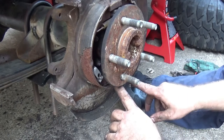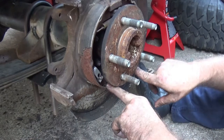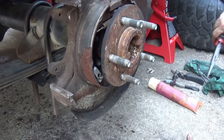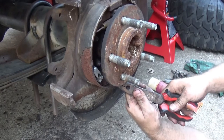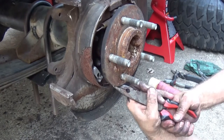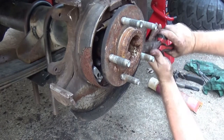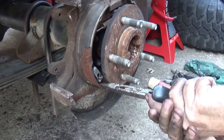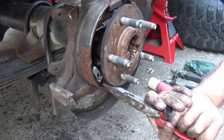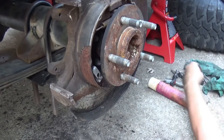The first thing we're gonna do is take this jigsaw puzzle apart. There's a spring way down below here — let's take that spring out. The hook is right there, it comes over to this side. Get your needle nose pliers, lay down on the ground, see if you can grab hold of that. Take your shoes, kind of pry them off the side a little bit to give yourself a little extra room, grab hold of it and unhook it. There's that one — it's off!